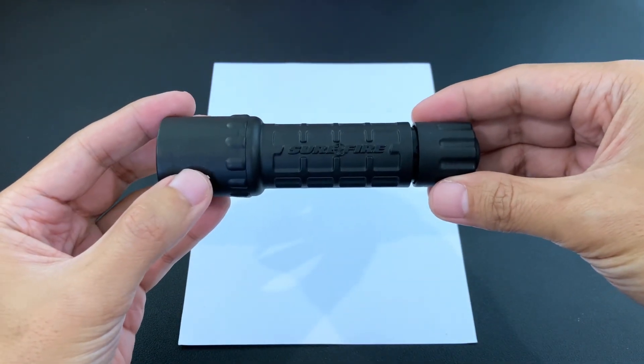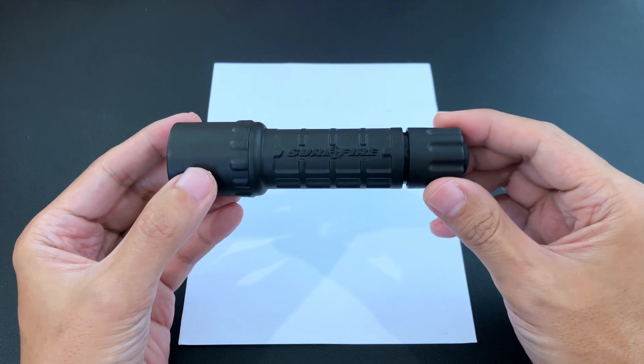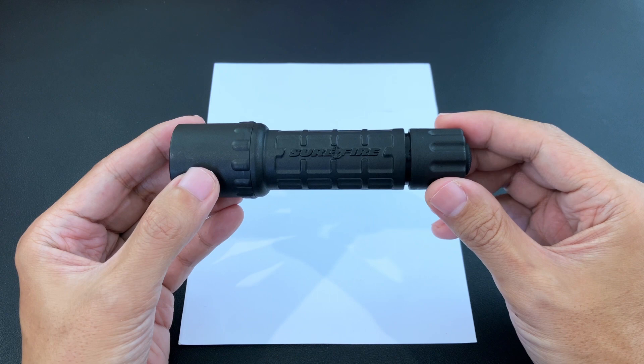I think we're good — that's a successful upgrade, although it took not just a simple battery replacement, but also an LED drop-in module replacement. The way I see it, this setup has a distinct advantage in emergency use situations, where you just grab any battery you find lying around and not worry about burning something out. If it fits, it should work. They should be able to handle both CR123 batteries as well as 16340 batteries. And of course, 16340 batteries have the advantage of being rechargeable, which should save a lot of money in the long run. Thank you for watching.